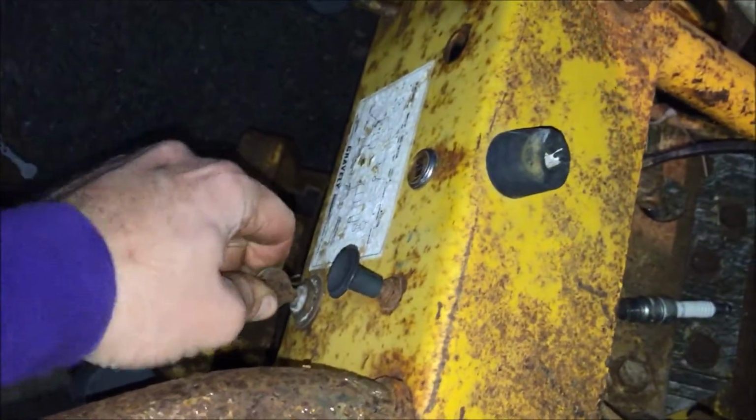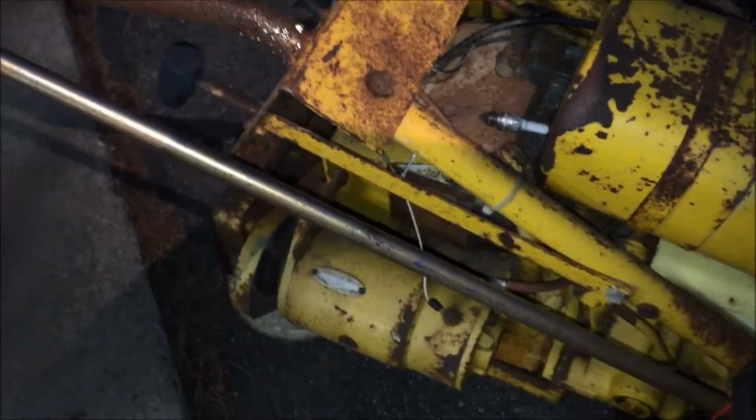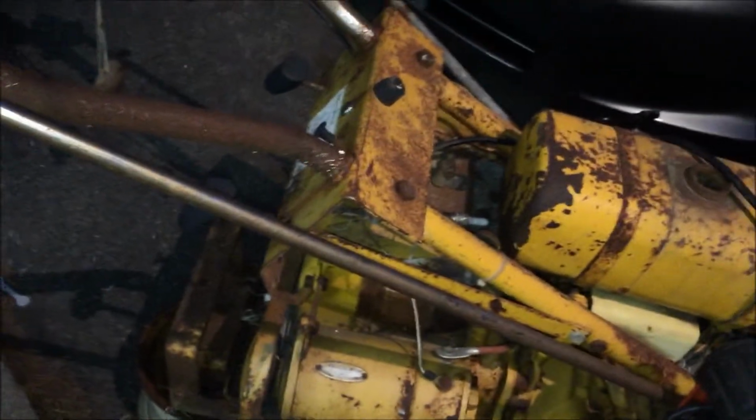And this might be a little harder for me to figure out because I think we're missing some wiring on this piece of crap. Let me just look at this for a minute. Let's see what happens if I hook up my jumper cables to the actual battery cables here. If the key works. I doubt it, but whatever, we'll give it a shot. Yeah, the key doesn't work, so I'd have to jump the hot wire on the coil to the battery. It's kind of a pain in the butt.